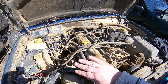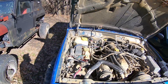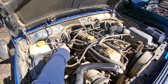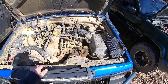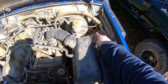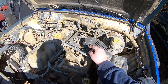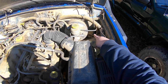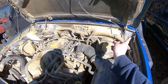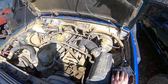The harness is all one piece on the 91-95, whereas the 97+ is a two-piece. This harness runs through the firewall in three spots — through there to your transmission controller which is underneath the dash, and through there which goes to the fuse box. It also runs through here, which means if you have to change this harness you have to undo your cowl and run the wiring harness from your windshield wiper motor.